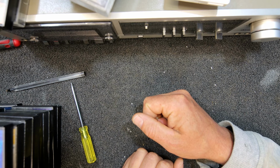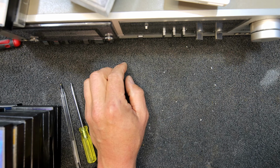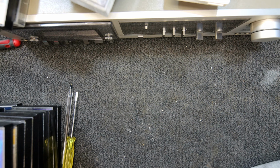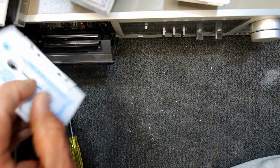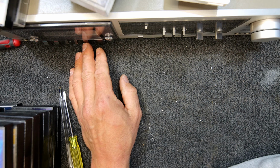So I might zoom that tape through and fast forward and maybe back again, because sometimes that will center them. I forgot they used to get off center like that. Still have no idea how, because really the rollers in the cassette should do it. I mean, it's possible if the head was far out in the cassette deck, it might pull it to one side, because that's about the only thing on the cassette deck. Sometimes you can get pinch rollers kind of pull to one side. So while it's playing, it's being pulled, and again the tape should sort of self-center again, but it may not.